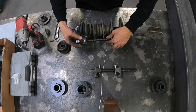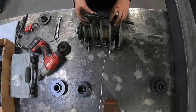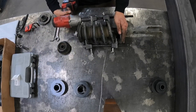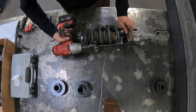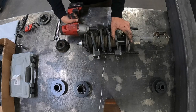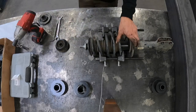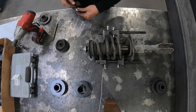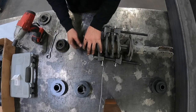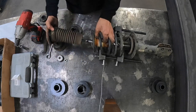Go ahead and get it onto a bench. You're going to want to use spring compressors — you can rent these from your local auto parts store, they usually do it free of charge, or you can purchase them online for around $40. Go ahead and compress the springs, trying to do it evenly on each side. Once fully compressed, remove the second strut nut on top using an allen wrench and an 18mm box end wrench. Then go ahead and remove the spring retainer, the strut boot, as well as the bump stop.